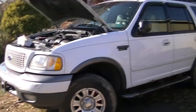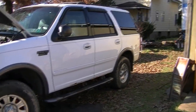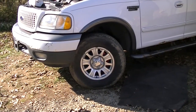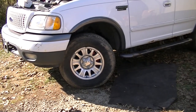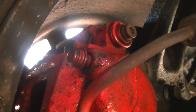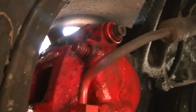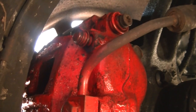So the first thing I'm going to do is double check all my wheel cylinders. My expedition sits up pretty high, but if you have a car that sits really low, you may have to jack it up and crawl under to check all four wheels and the master cylinders for leaks. The left front driver's side — there's a bleeder and I see no leaks. This is in good shape and I replaced the brake pads not long ago. Let's go check the passenger side.